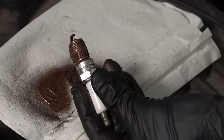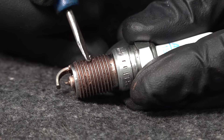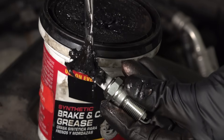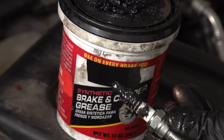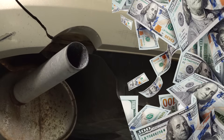If you use copper never-seize, it's going to go on the threads, which is probably great on bolts or some other application. But on a spark plug, you actually want to make sure that you have a nice tight seat of the threads between the spark plug itself and the engine. Any type of additive in between that spark plug and the engine could cause an issue with the groundability of the spark plugs. You might start finding that you're losing spark, getting spark, losing spark, or even losing compression from inside that cylinder. When that happens, you're going to be wasting a whole bunch of fuel, which means wasting a whole bunch of money.